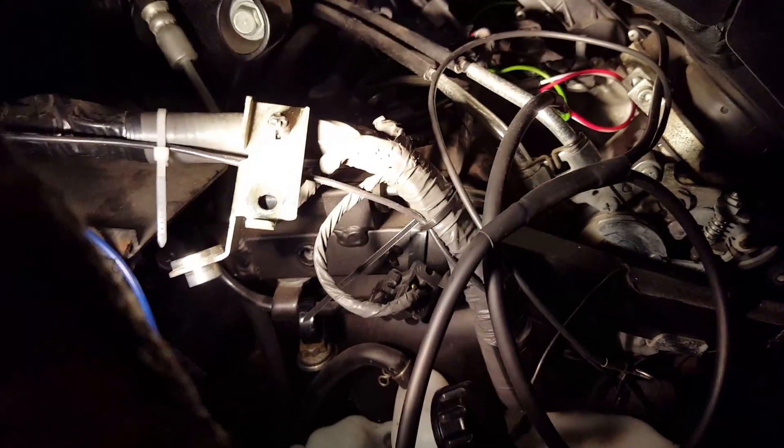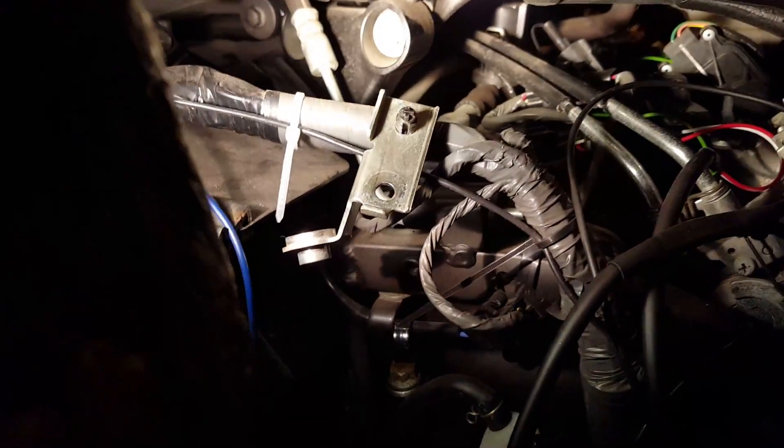Some folks are saying there's not a lot of space to work, but if you take off the bracket that holds the wiring harness on the left side and unplug this connector and the one right there, then you're free to move. I didn't really need tools — it was easy. That concludes everything. I'm going to do a demo probably tomorrow and start zip tying and closing the bike up.